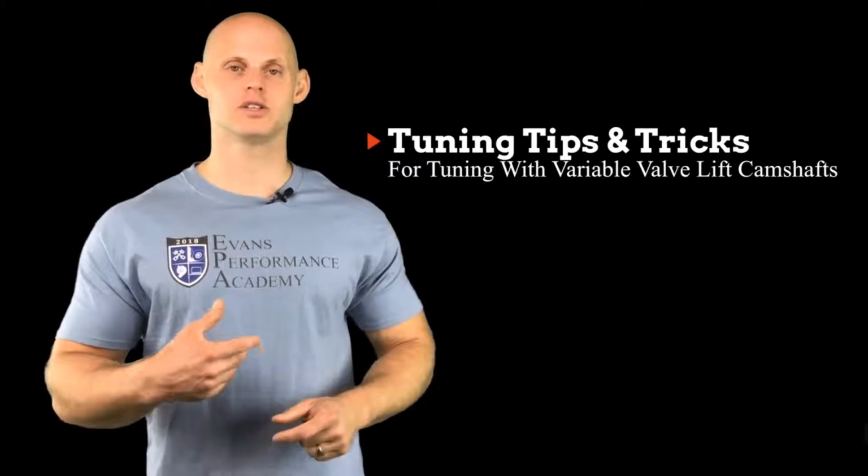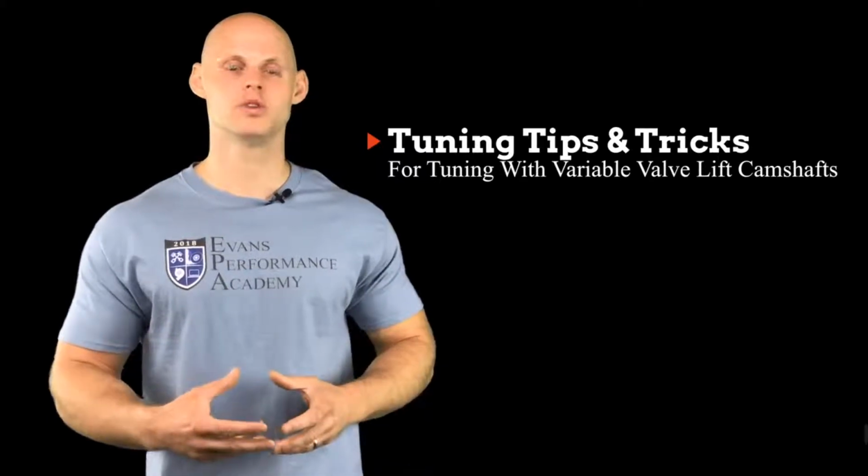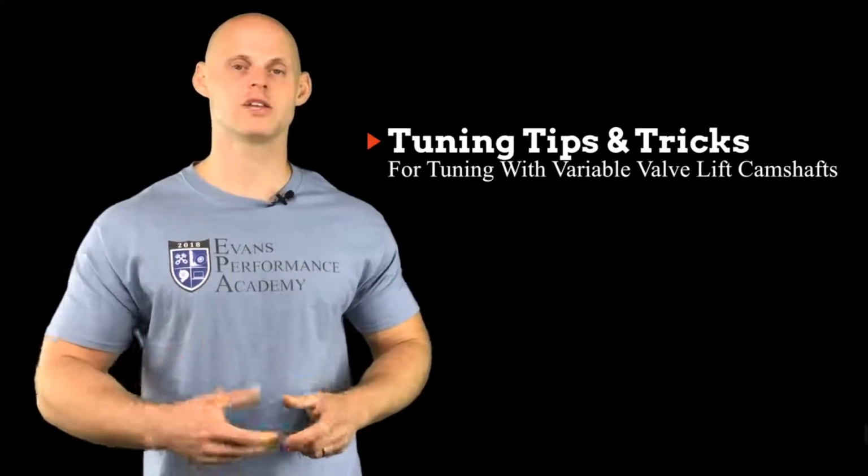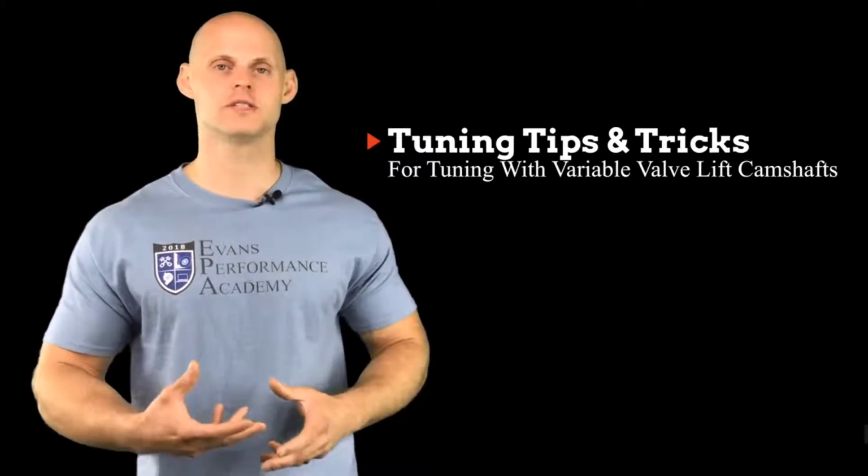We are going to find that same optimal point where we're moving our VTEC point down and trying to figure out the lowest we can run it. And we're going to find that the engine starts to bog out and doesn't really want to make any more power or spool the turbo faster. That's because we're going to have that backing up effect during the overlap period, where we have the exhaust pressure pushing back into the chamber. We're going to have the opposite of the scavenging effect, reversion, and we want to avoid that.